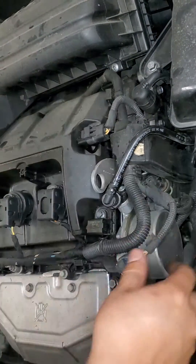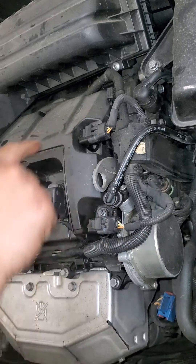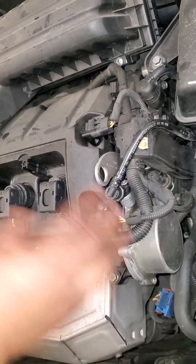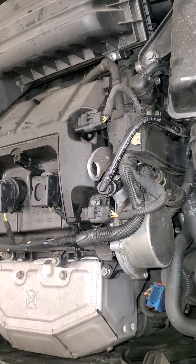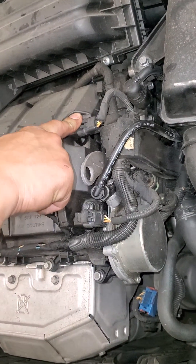Make sure that's all the way in. Plug it. And make sure while you're doing all this that the key ignition is out of the car, out of the slot. Now that everything is all connected, we're going to clear the fault codes and run the engine again until the check engine light comes back on. Hopefully it'll show the intake camshaft sensor this time.